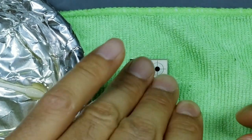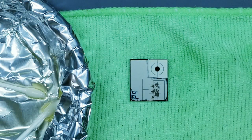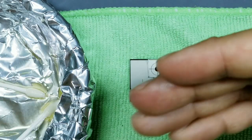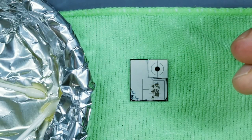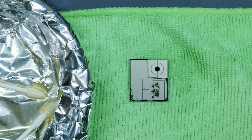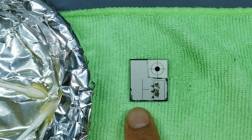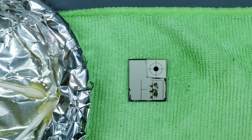That's just because you're pushing down on the layers of the display, and for some reason those parts are popping up. However, when we reassemble the internal watch module, we're going to use our paperclip to reset the watch, almost like what you would do if you do a battery change. And what that does is it kind of wipes out the display, makes it completely clean, almost like erasing an Etch-a-Sketch, and then the normal time, the normal characters will start to appear. So completely normal if you start seeing stuff like this, okay?